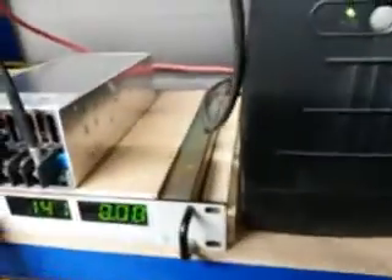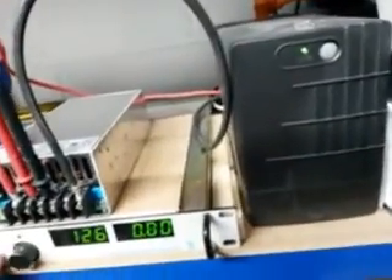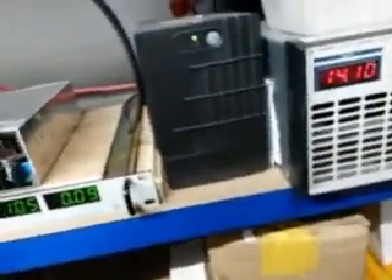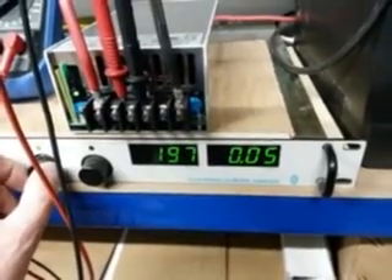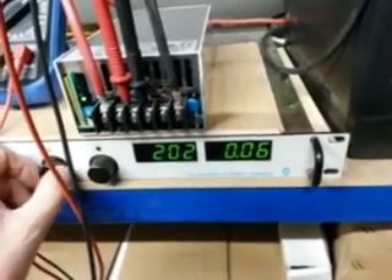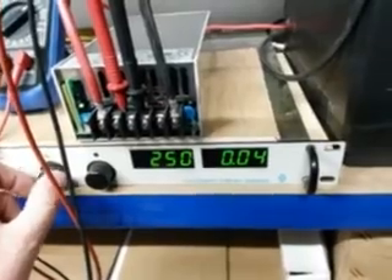I've overcooked it — I tripped out my high voltage supply. Obviously you wouldn't have that problem in real use, so I'll have to restart it. Right, we're off again. I need to give it more voltage because my supply can't supply the current that the IMA motor would be able to. I'm going to turn it up to 250 volts — if you're revving the IMA hard, you could be getting this.